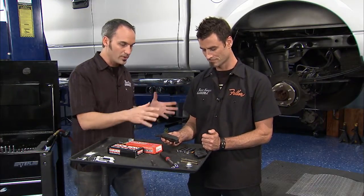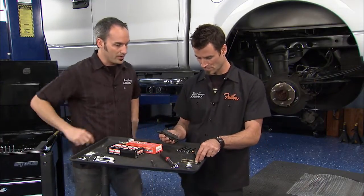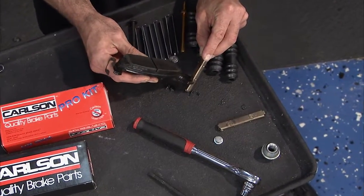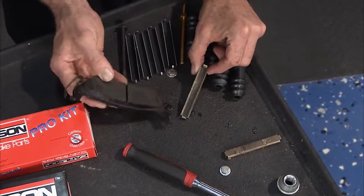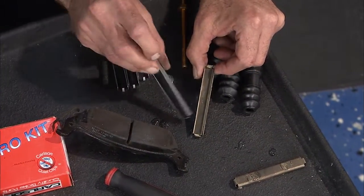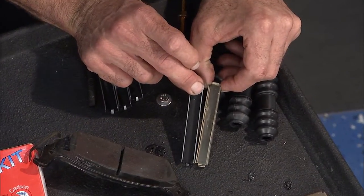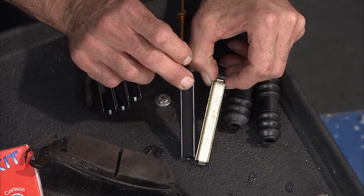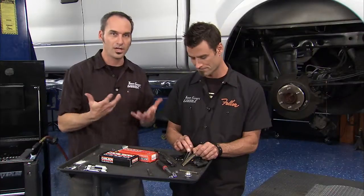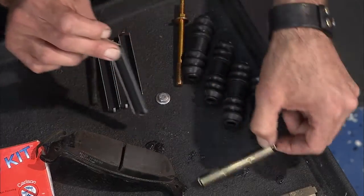We've got new hardware all the way around, which is going to be great, but even these new sliders have some upgrades on them. Let me show you the original — the way this would ride, you can imagine them kind of tapping on each other. Flip it over and see the difference in the new Carlson and the old one. There's actually a little coating in there — a nitrile polymer coating — that's going to help quiet it down, like putting a little thin blanket inside of it. It's like sound deadener that you put underneath the body of your car — same kind of idea. You're absorbing more of those vibrations, so less of them are going to get transmitted into the air and into your ear.